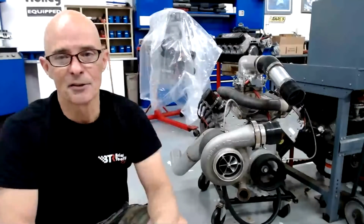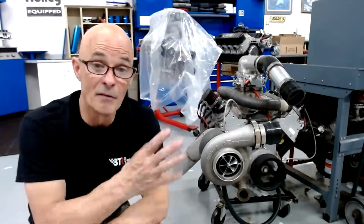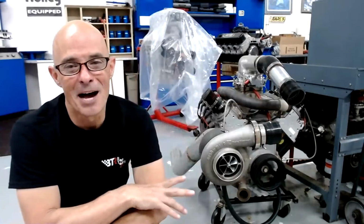Yeah, well, Tom, there are guys doing 1,000 horsepower stuff, I think, with B series. There weren't a lot doing it when we did it back in the day, but I think that was 29 pounds, and I only ran it there because Mahovitz loaned me one of the 76 millimeter turbos that he had from his mod motor car, and we ran that on the dyno. I've never run that turbo in the car. We only ran a 72 millimeter, and I've never run anywhere near that power.